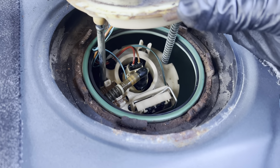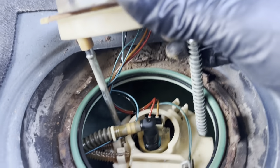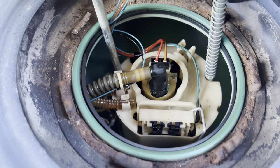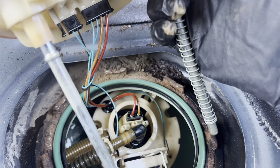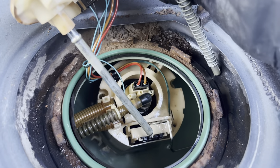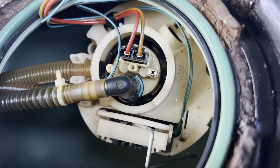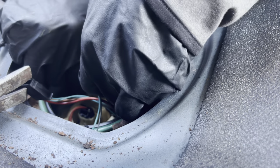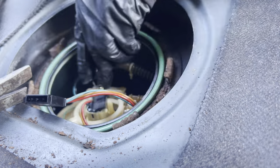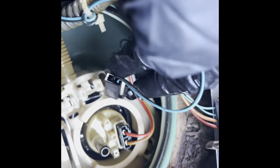You want to be sure not to drop anything in the tank. These are the hoses coming from the other pump on the other side — those three hoses there we're gonna have to connect. I'm gonna unplug this stuff and then put the new stuff in. Press in the green tab on the top hose and once the tab is pressed it should pull up. After you get these three hoses disconnected — this one is easy, just press that and lift it up, and the other ones are just clipped into little holders.